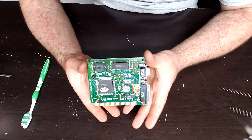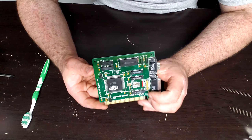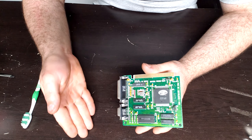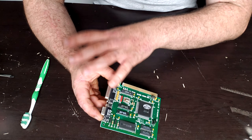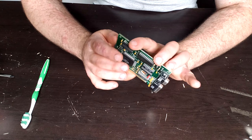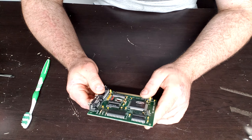The final card pulled out of this thing is the video card — the bracket is still off, I haven't found the little nuts. This is the NEC MG160N Revision B — a pretty nice Hercules clone card. These were actually really neat because they let you upgrade a 5150 that had MDA graphics to have single-color CGA-style graphics, combining the crisp clear text of MDA with the capability of running single-color graphics on an MDA monitor. Unlike MDA cards, this one has 64K of video RAM — just a lot for what it is. It also adds a compact parallel port on top of the multifunction card.